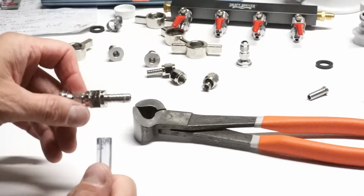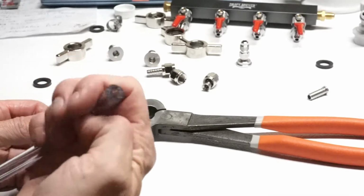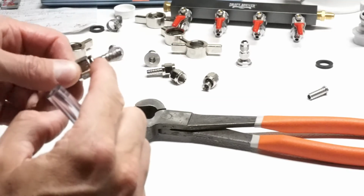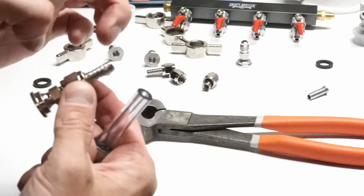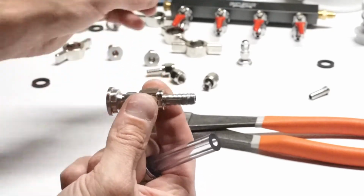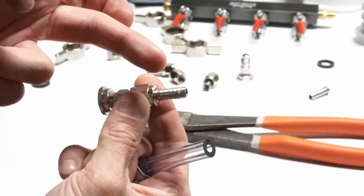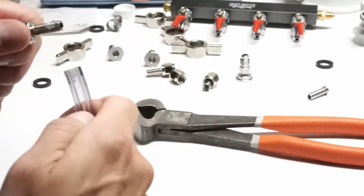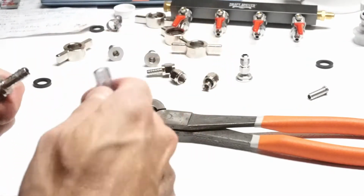So one thing I should note is when you're using this gas line, which is 3/16 ID, it's pretty thick walled. Between that and this tapered end, it's quite tight. This piece is also loose from the nut. So I have this little MFL, which is meant to connect to, threaded up in there so it can't move. So hose clamp, and you just have a little bit of wiggling just to kind of show you the difference of how these things work if you're not familiar with these.